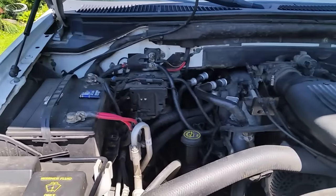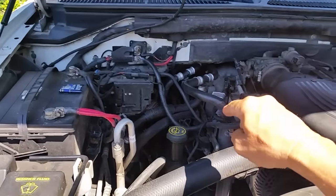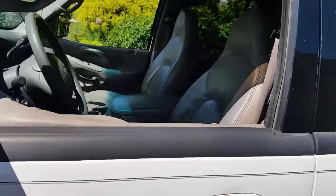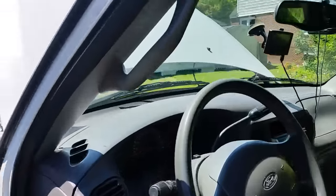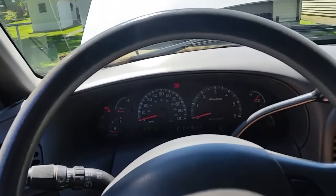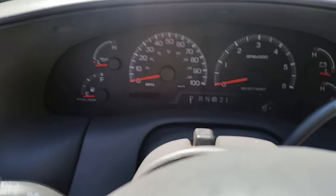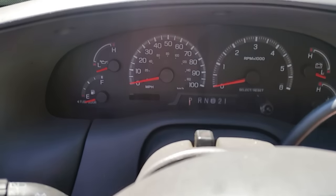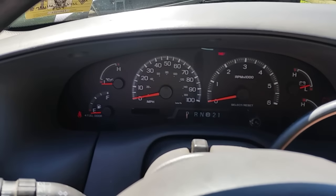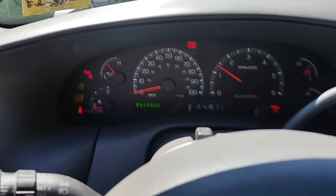We've given you the story on the fuel pump, hit the starter on the top and the bottom with a hammer — now let's go inside and see if this thing starts up. Remember, if you're having a starter problem and you get it running, don't shut it off until you've done your errands. That way when you get back you can do the work on the car. And voila — it is running!